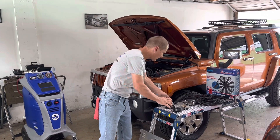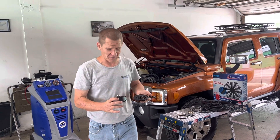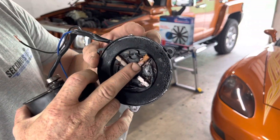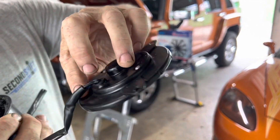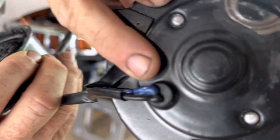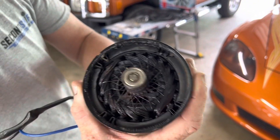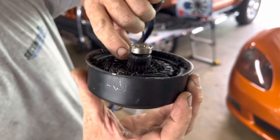Pulsing the power through the brushes makes the brushes try to fuse to the segments on the commutator in the motor. I actually have this motor taken apart so I can show what that looks like. It smells like it's been on fire. Here are my brushes — they're all destroyed. This one doesn't even come out anymore. The wire is melted coming out of the back of the housing and the motor itself looks like it's been on fire.